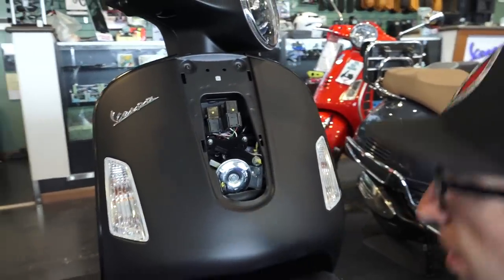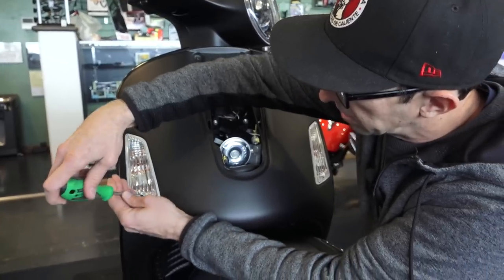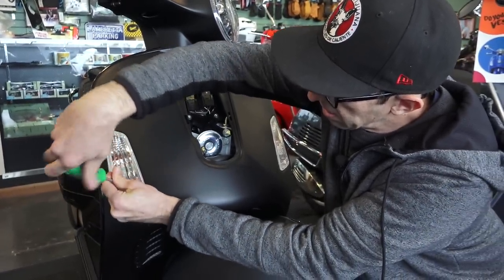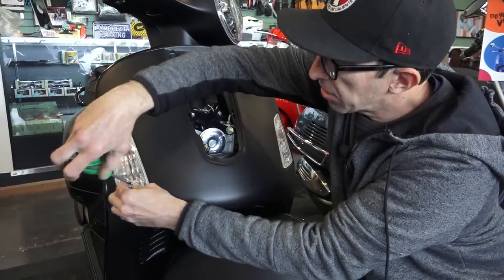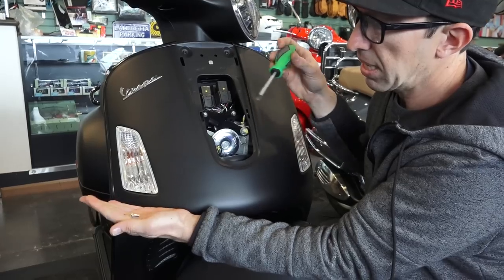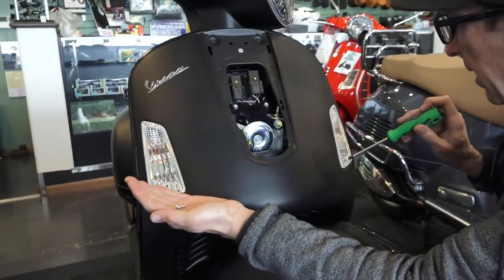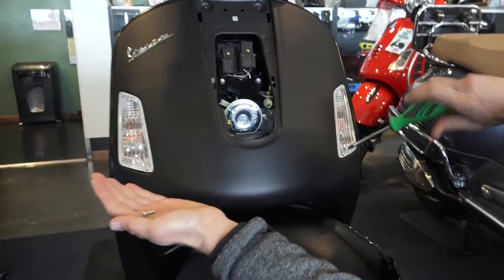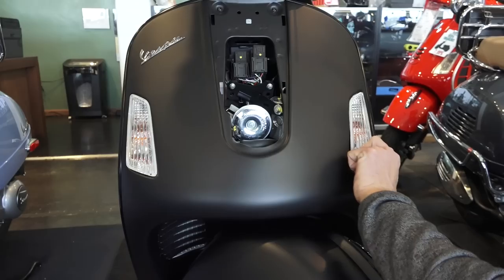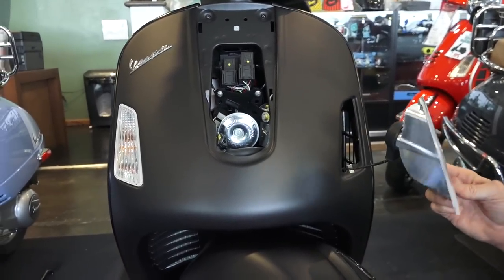Next, we'll remove both the left and right front turn signals. Pretty simple operation. There's a single screw holding the lens in place. One thing to keep in mind, you could replace the screw with a black screw. You'll see in the description the part number for the set of four screws that are stainless steel, black coated screws. They look really nice with the tinted turn signal lenses versus these standard zinc plated silver screws. Just pull the turn signal right out, pretty straightforward.